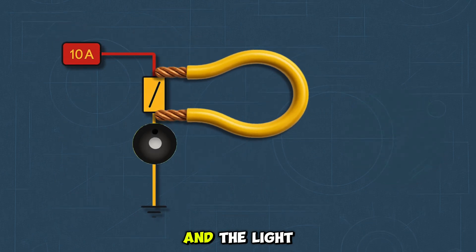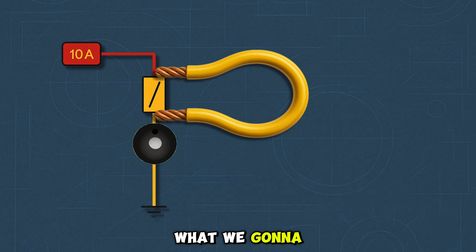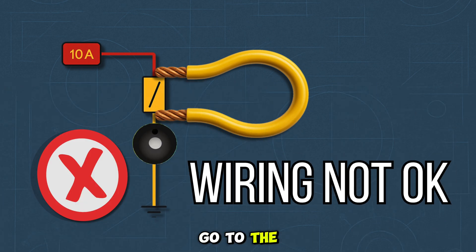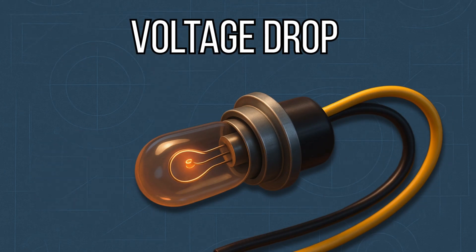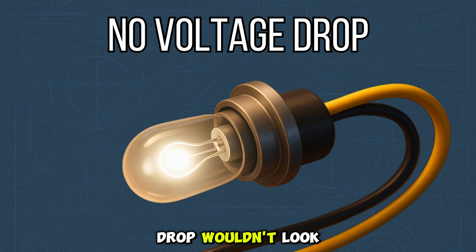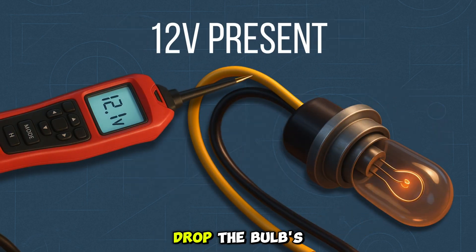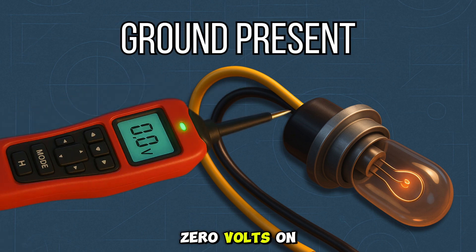What if we bridge it and the light doesn't come on? That's more likely - we see that a lot on cars nowadays. What we do then is go to the light first, open it up, power it with a power probe. If it lights, the bulb is okay and the light is okay. What about if we have a voltage drop from the switch? If you've got a dim bulb, you've got a drop; if you don't, you haven't. If you've got a voltage drop - bulb is dim, 12 volts on the power supply, and zero volts on the ground - could it be the wiring? Yes, because we're not loading the wiring with anything.